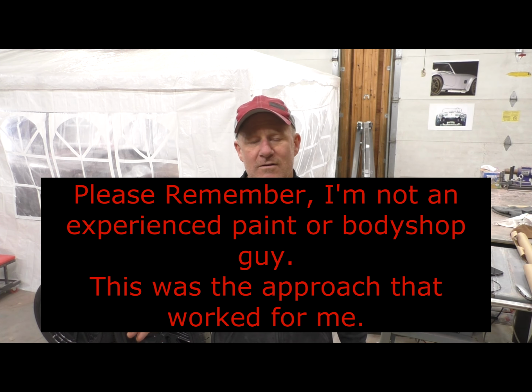So first, you saw the body work, lots of sanding, a lot of attention paid to any of the mold seams. And so I basically got the whole car to the point where I was pretty confident in its flatness, and that was done by blocking. I blocked down to, I think, 220 before I did any type of priming work. So blocked to 220, and then I DA'd the whole car down at 320, very light on the touch, and I stayed mainly on the flat panels, then went at the other parts by hand with varying degrees of softer blocks.